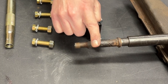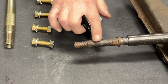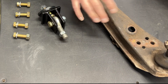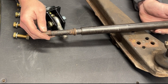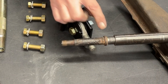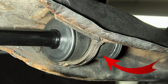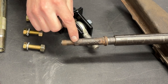The problem happens during two specific activities: accelerating and braking. Because the bushings are rubber, they flex, and when we accelerate hard or brake hard these bushings have the tendency to compress. That causes the control arm to move fore and aft — not as drastically as I just showed here, but it will move, and that creates minor steering issues and can affect how the vehicle handles, especially on a performance ride. The other issue is there's no adjustment — a washer goes on each side with rubber bushings fitting into the pocket, and you tighten the nut down.